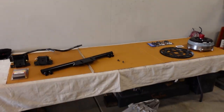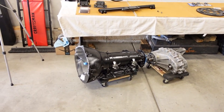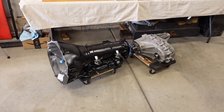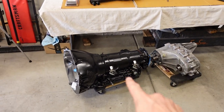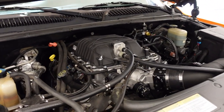We're swapping out the two major components of the drivetrain. We're replacing the most mediocre 4-speed automatic GM has ever built with what is probably the strongest 4-speed automatic they've built — and that's the 4L80. Normally these come in heavy-duty trucks, buses, and a wide range of vehicles. This one was rebuilt when I got it, but it was a stock rebuild. We took it apart, dual-fed the directs, put a shift kit in, and some other hydraulic tweaks. We've got ourselves a rock-solid transmission that'll hold up to probably 750 or 800 horsepower without a problem.